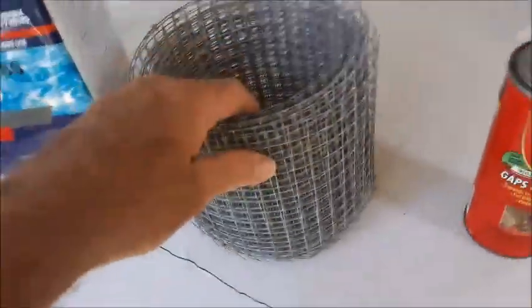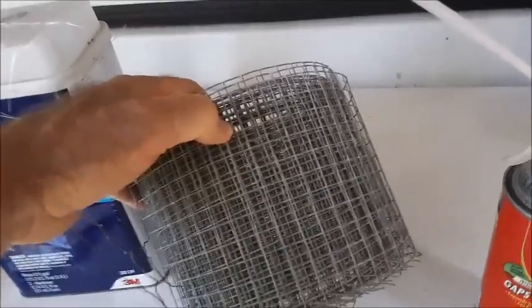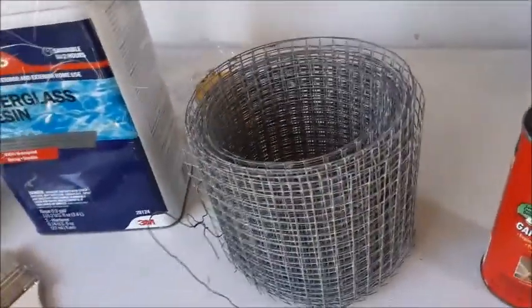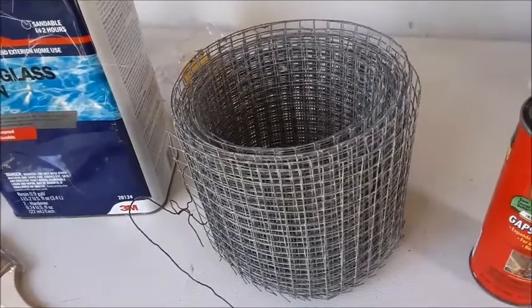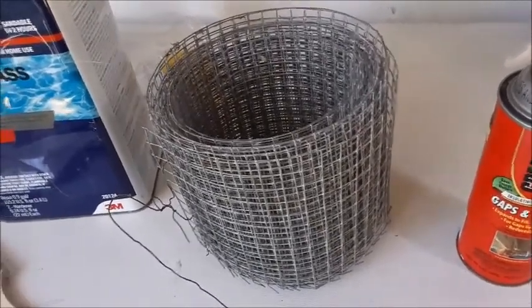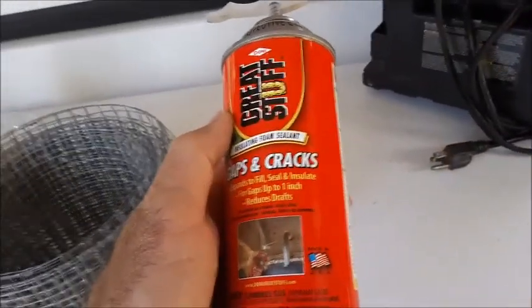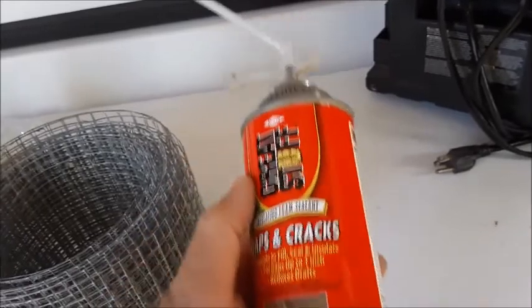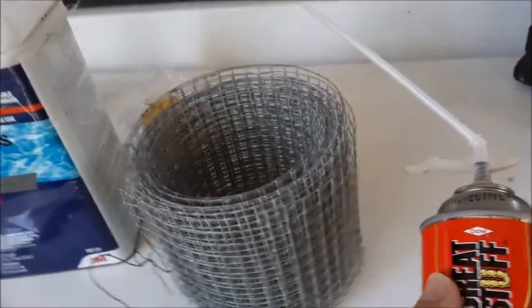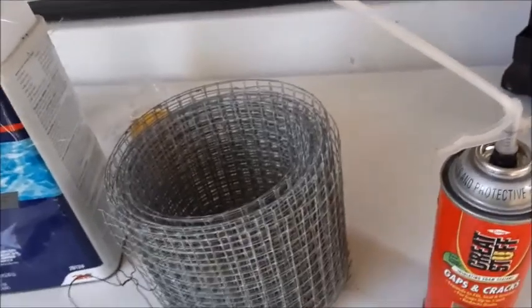The other product is some half-inch wire mesh, which you can cut with tin snips and mold into different shapes to be screwed into the bottom of your camper in corners and similar spots. You may want to use that in combination with spray foam. The spray foam can be chewed by rats, but if there's wire mesh in the middle of the spray foam, when they start chewing it they'll run into the wire mesh and can't get any further.